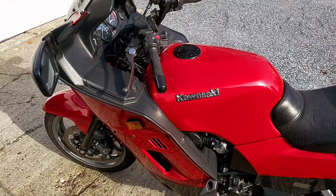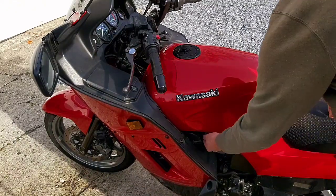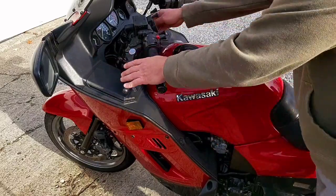Again, this is a personal preference, but I've always had the best luck doing this, and I do the same thing to tractors, generators, four-wheelers and whatnot. In the springtime, you don't have any fuel gumming up in your carbs and fuel lines from sitting all winter. Even though I do have stabilizer in it, I'm probably fine without doing this, but I've always done this and never had any issues. So let's get the bike started again and let her shut off.